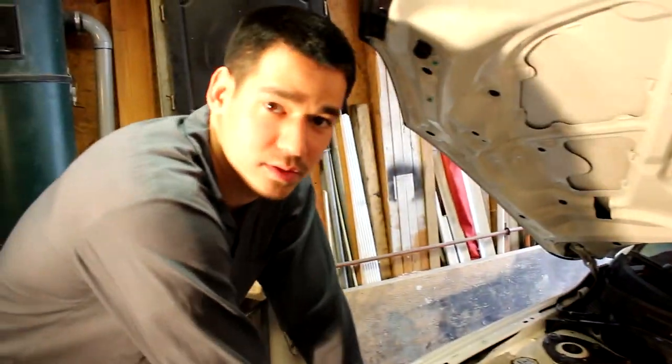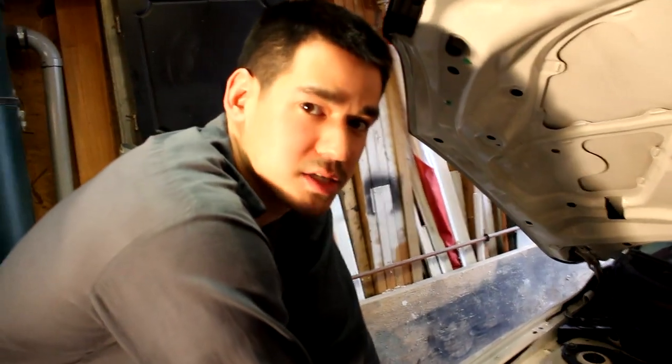So the reason why we're going with the Under Route piping kit is because we've noticed that these pipes get a lot of heat soak in them. You'll notice this pipe is right next to the exhaust manifold and the pipe running down is right in between the radiator. So it's absorbing a lot of heat, and boost air temperatures haven't really improved ever since we've gone with the front mount intercooler setup.